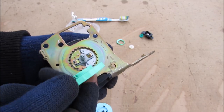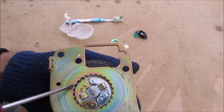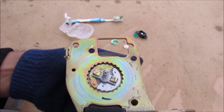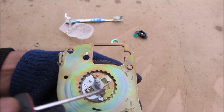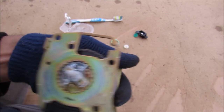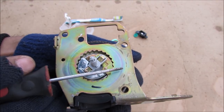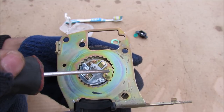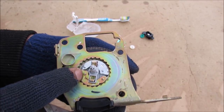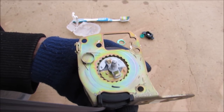If I remove the retractor gear, inside we have two metal lockers that will lock this retractor shaft onto the housing spline with these teeth. They operate by the principle of centrifugal force — if you're pulling the belt slowly, these stay in place because they're attached to the spring through the gear we saw earlier. But when you pull on the seat belt really quickly, these will lock up. From centrifugal force they push outward as the reel rotates, causing these teeth to engage with the teeth on the housing and lock your seat belt. To unlock it, the return spring pushes these two cams together away from the gear, allowing you to pull the seat belt out.